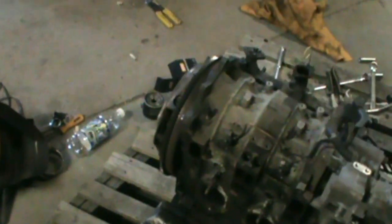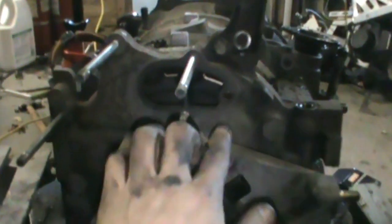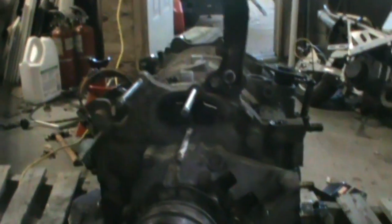I'll show you guys the parts pile — there's quite a bit now, parts everywhere. I'm just going to get working on the front. Once this whole piece comes off I can take it off all as one assembly, then take off the oil metering pump. Then probably take off the engine mounts and the oil pan and basically it's ready for the teardown. I got the water pump housing off — there are four studs and one more long bolt, and the whole water pump assembly comes off as one. I took that off and got the oil metering pump and the little oil injector nozzles off.